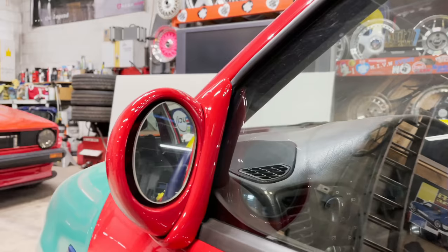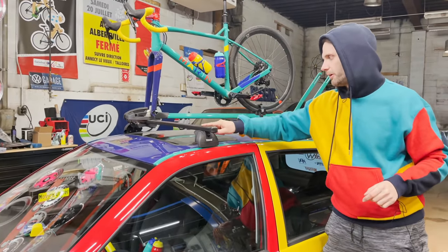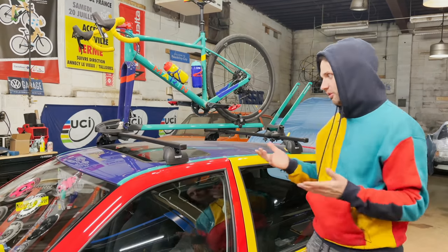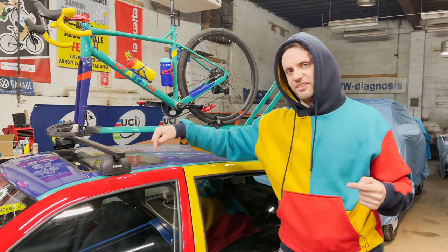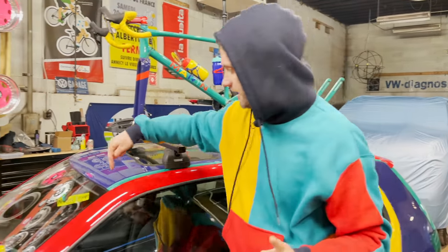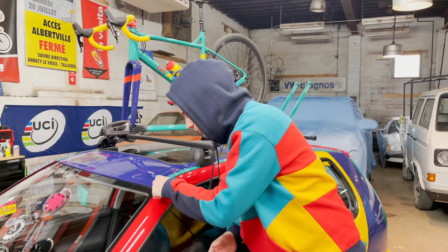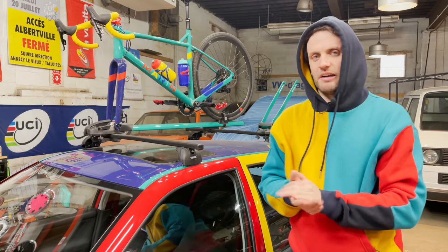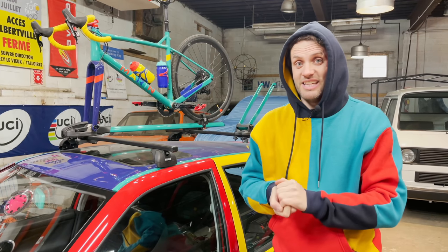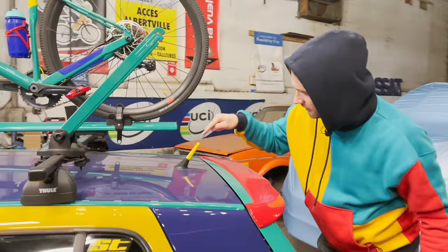Back to the Polo - there's a lot of goodies in here. Trying to keep it period correct, so the mirrors, the blue side markers, everything. Thule did help out with the roof rack - these are standard crossbars. The fit kit is not available in the USA, so Thule got it from Sweden and shipped it over. These are not Polo 6N roof rails - you can go to a 6N2, the facelift version, and they bolt on directly. However, as I realized last minute in Europe, the windshield is a different shape, so this car after painting has had two different windshields. The second one has a little more of a rectangle fitting, which was very last minute - the great guys from MIVW helped me pull the window at like 11pm before it went to the boat the next morning.